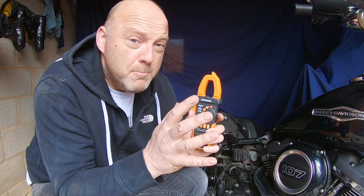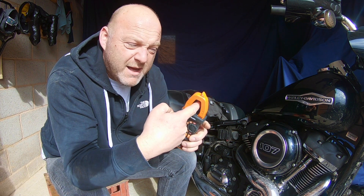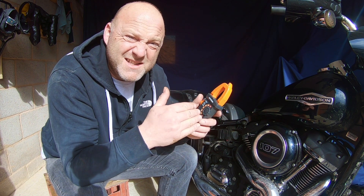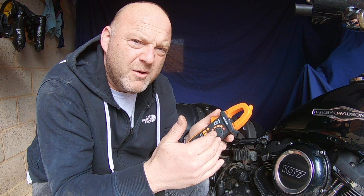You might need something bigger depending on your motorcycle. Basically you open the jaws, put the negative cable from the battery through there, clamp it, and measure the total amperage. We're going to run the motorcycle at 3000 RPM — just to take it out of idle for a consistent reading, and because at 3000 RPM we know that's getting a consistent level of charge from the alternator. It's basically just a datum.